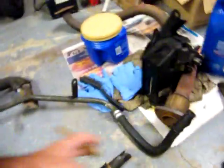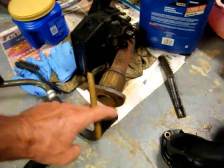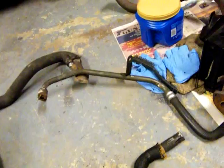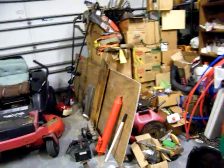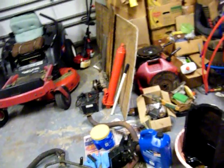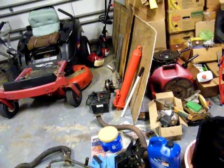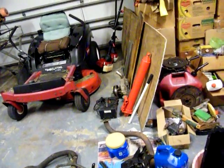The only difference is this one right here no longer exists — they just make them out of hose now. I guess they just said to hell with the metal pipe. But it connects right there off the back of the water pump, so those are located and I'll order those next. And then I'll order a power steering pump as well. I pulled the pulley off of it with no problems, really — just needed a little muscle on the first two or three twists to get it moving, and then she just comes right off.